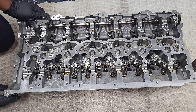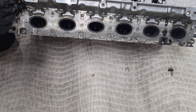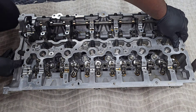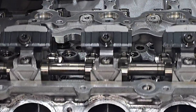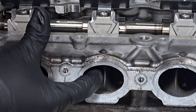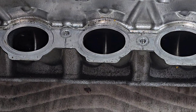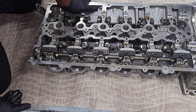We've got our exhaust ports — these are oval holes where exhaust gases come out to go into your turbo. On the other side you have the intake ports — again big oval ports with two valves per cylinder, so it kind of splits down the middle of each port going into the valves. But yeah, everything is pretty much what we've talked about in other videos.